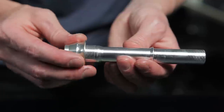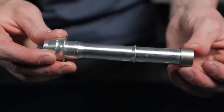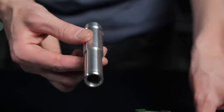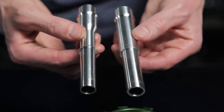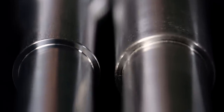Legacy axles featured a floating drive-side end cap and a preload adjuster on the disc side. Hydra axles remain adjustment-free, but their tapered center makes them easily distinguishable from Torch. With Hydra, the diameter of the axle has gone down from 17mm OD to a 15mm OD.